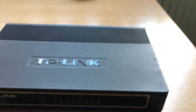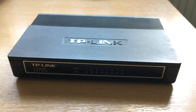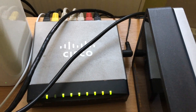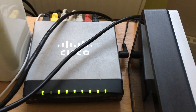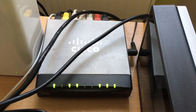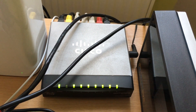These things work particularly well — they're really good, cheap and cheerful, they do the job. But they're not particularly sophisticated, so if you want to do something more advanced such as bonding ports together, creating link aggregation, or looking at quality of service where you're prioritizing certain network traffic, then you'd want to move on to something like this. This is my Cisco switch that I've replaced that TP-Link one with. It's a managed switch, which means you get some software you can access through a web browser and configure things to make your network run a little bit better.